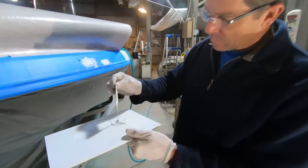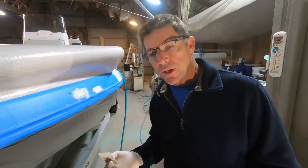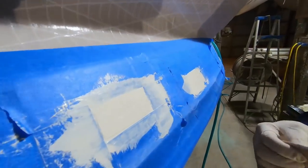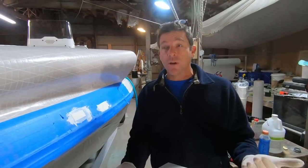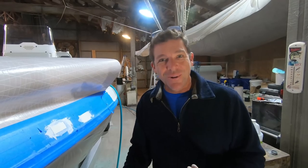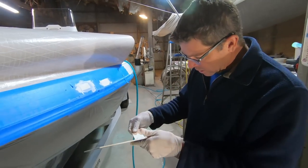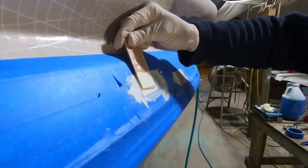About 10 more minutes have passed and we still have the original batch of gel coat, but you can see it is starting to thicken up — that's pretty typical. It'll be thin when you first mix it and it'll get thicker as it gets close to curing. You kind of have to time it. I'm trying to get multiple coats in this afternoon. At home you could apply one coat, let it cure for several hours, then come back. I'm trying to get three coats on tonight — sometimes two coats on a thinner application — but we're going one more pass because that was a pretty deep divot.